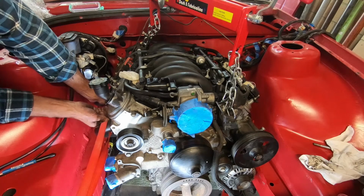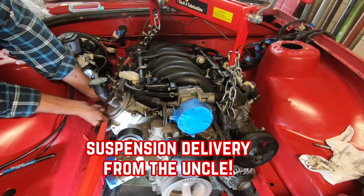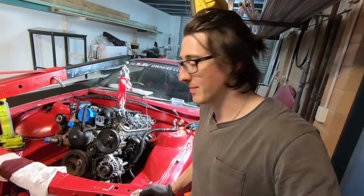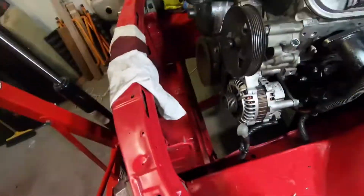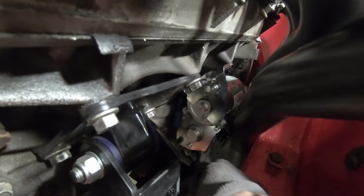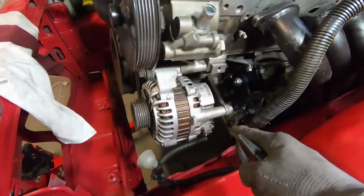What's all that? It's all the springs and shocks that came out of my car. So the engine is back half out of the car. Had to jack it up again so that I could attend to a few things, which I'll show on the list in a second. One of those, while I'm here though, is to put the starter motor wiring down the bottom here, bolted on. Spade connector goes in there. It's impossible to do it once it's in the car with the headers on and everything. So I'll do the alternator as well.